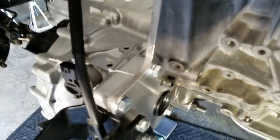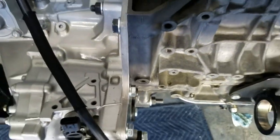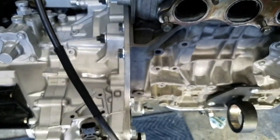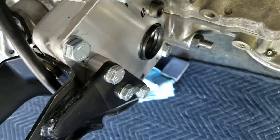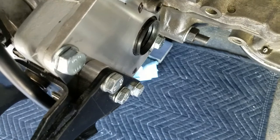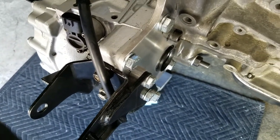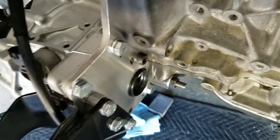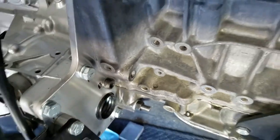Here is the piece I was talking about for the transmission. Here is how it's straight - you see how it lines up to just ride on the transmission. You've got to take that piece out, and here is that spacer that comes with the kit. It allows you to use the stock rear motor mount bracket. Everything else is pretty self-explanatory - A with A, B with B, C with C.